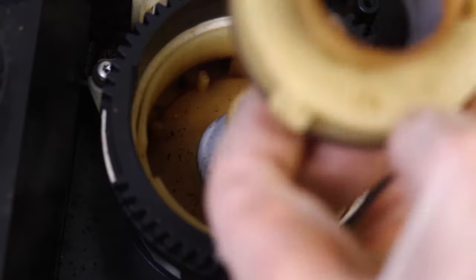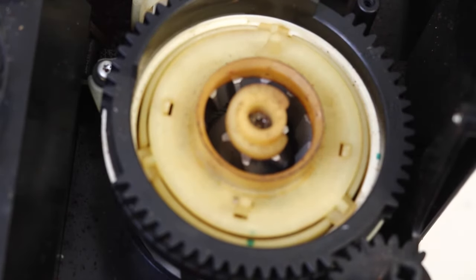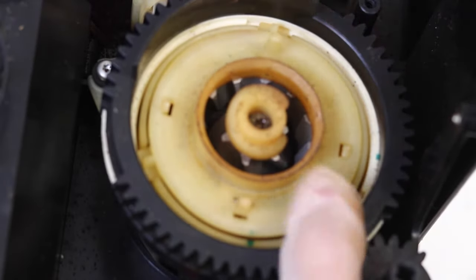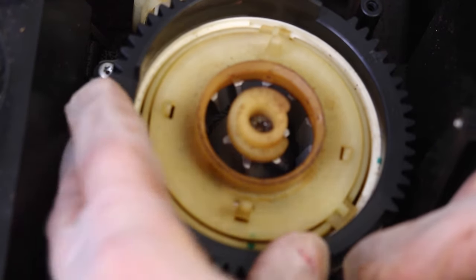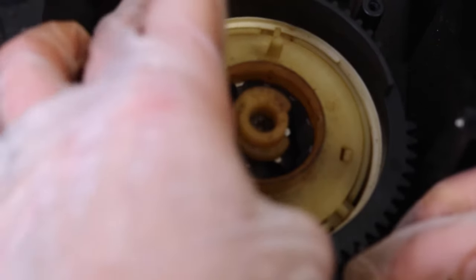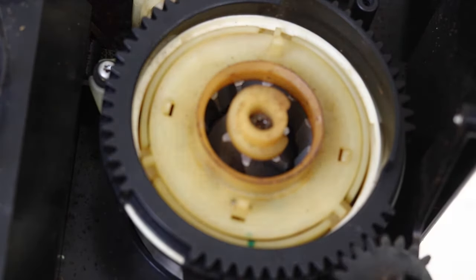Drop the assembly in. You can see the two green lines have attached. Tilting back and turning clockwise, align all three green lines. The purpose of this alignment is calibration — we're returning to the origin position from where we originally removed the burr.